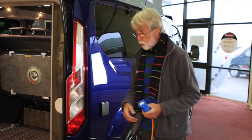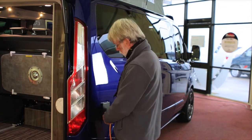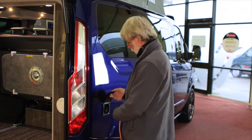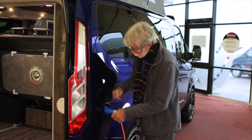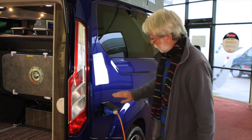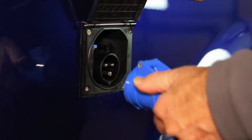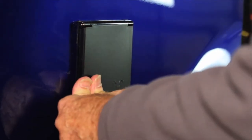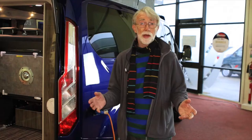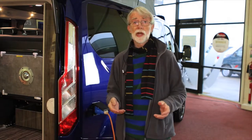Hooking up on site is pretty straightforward. Make sure your master switch is off. Sometimes people find this panel very stiff to open, but get your fingers over it and give it a good pull in the centre. Open the cover on the mains lead, connect the pins up, in it goes and you're hooked up. Back in the van, switch your master on. When it comes to disconnecting, pull down the little blue lever and out it comes. Don't forget to secure the flap — push securely on each corner in turn and that keeps the water out. If you're planning to travel abroad, have a look at your user manual and talk to your Ford dealer or Wellhouse Direct about the different gas systems and electrical hookup systems available on the continent.